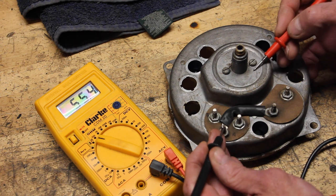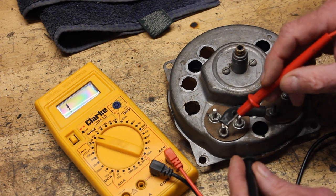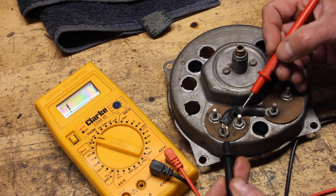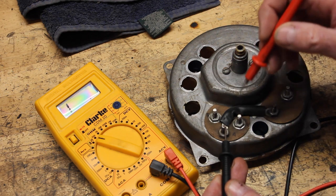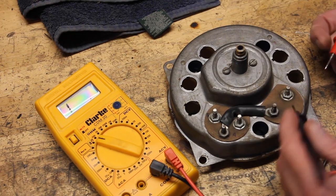A to ground should be between 49 and 51 ohms. Perfect. So I know that the resistance going through this fuel gauge is right within spec. If any of your readings are not within those thresholds, it's more than likely that something is wrong with your fuel gauge.